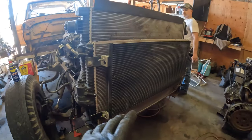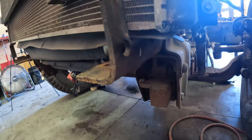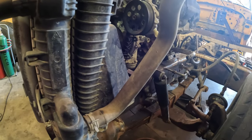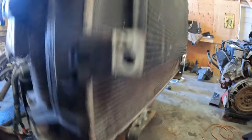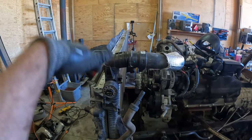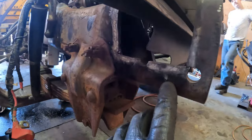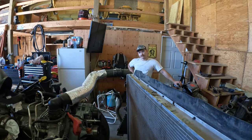We haven't cleaned up the frame yet — we just wanted to test fit it to make sure it looked good. The right-hand side actually fits now. Obviously this isn't its final resting place; we are going to build mounts back for the original mounting like in the Super Duty. This side over here we have to trim up a little bit more to get it to set down, but it's almost in the exact factory position as the Super Duty. If you look at the coolant hose — once it falls back into place and the far side is down — it will be pretty close. We have enough room to shim it up or shave it off a little bit.